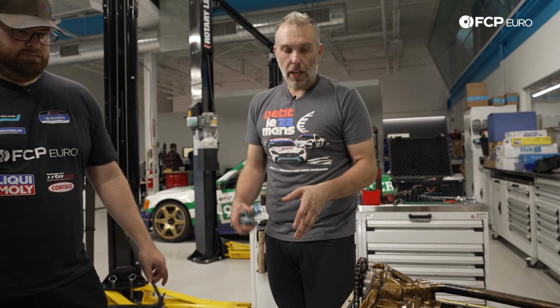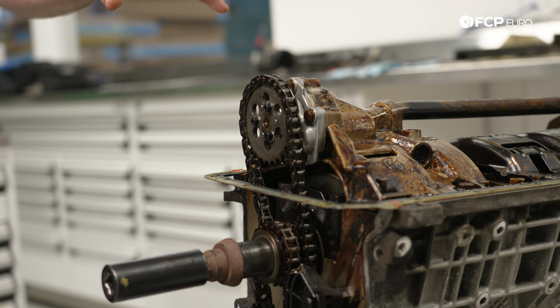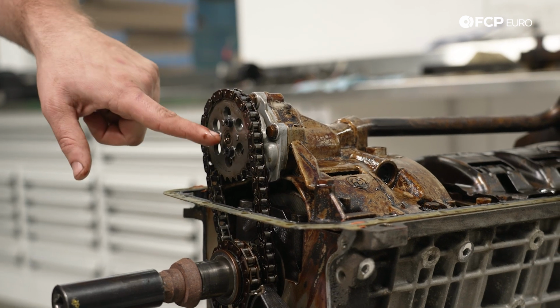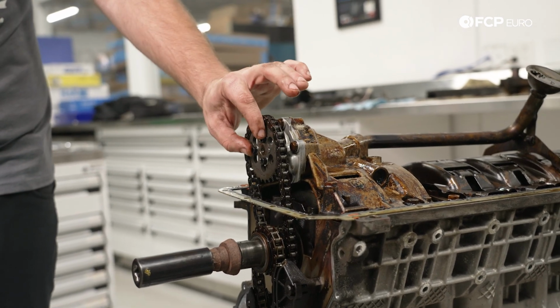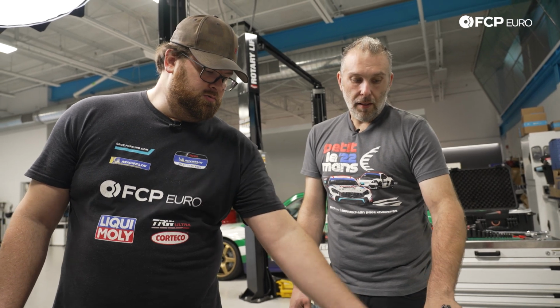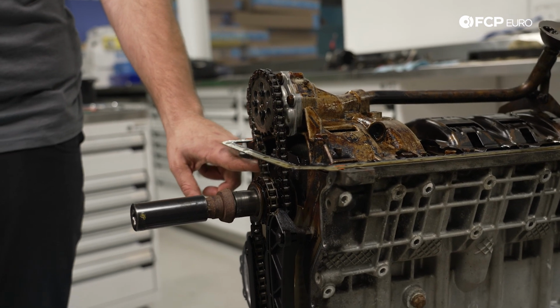One thing on these engines compared to the Euro S50 or the S54: they use a very similar oil pump timing chain arrangement, but they have an actual tensioner that pushes on this chain. So you can see the amount of slack that's here, that's normal. We're talking high engine speeds, lots of gear shifting. This chain is going nuts the whole time. Granted, that nut is reverse threaded, so it's not supposed to come loose, but this slack basically acts like an impact gun on that nut and could cause it to come loose. So this modification is intended to prevent that from ever being a problem. And correct me if I'm wrong, but can't you fit an S54 tensioner onto this engine? Yes, you can. You have to drill holes into the block and put dowels in, but there are also some other options out there for adding a tensioner. So that's a nice added redundancy.